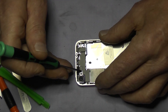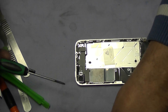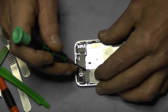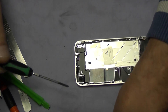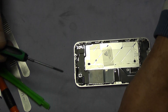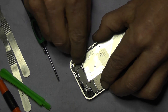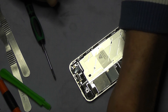Then there are the two screws near the camera. This next one is the smallest screw — it is a very very tiny screw, so remember where that really tiny screw goes. These two screws are the same as this particular one. Now that is off — just slip a craft knife gently behind there, pull the tab back, and you should find that the plate will come off.